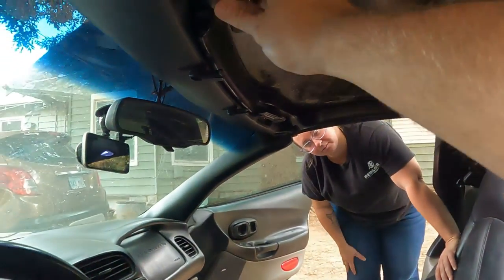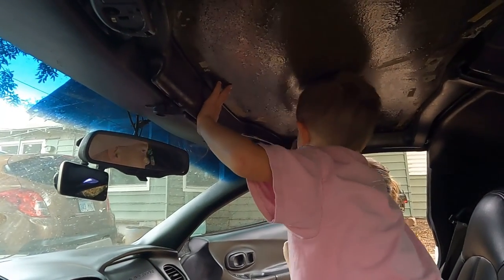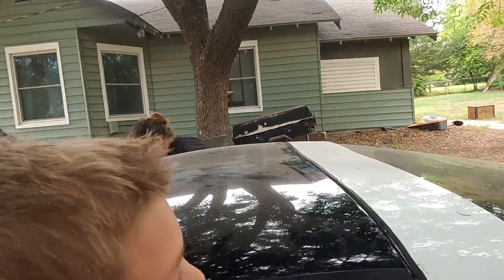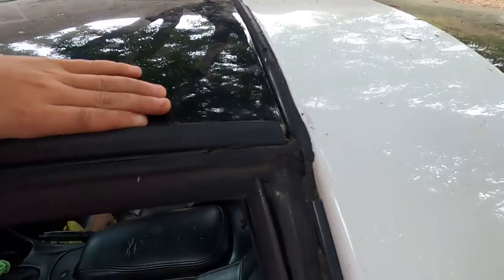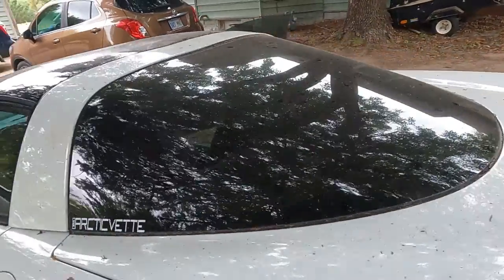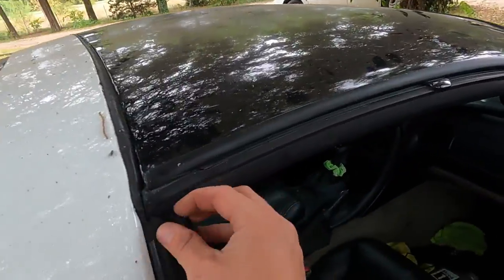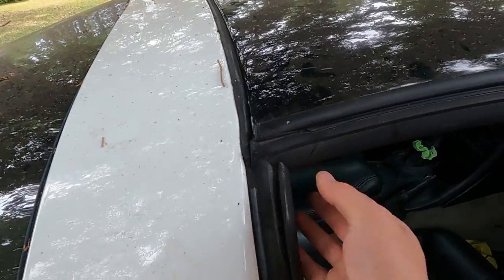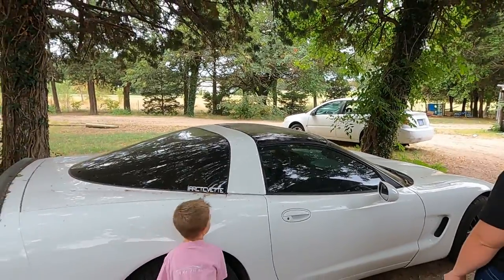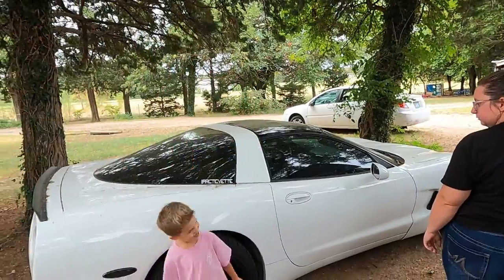Pull it and push it all the way in, then you've got to turn this to lock it in place - that one too. Now your targa top is locked in. The last thing is to make sure the weather stripping is seated right there. Cohen, thank you - it's popped out. So over on this side we'll check the weather strip here too. Now you're good to go - that is how you remove and replace your targa top, and that's going to be the process of how we repair the top.